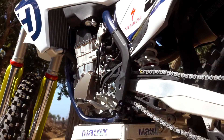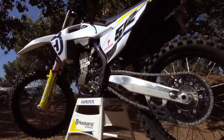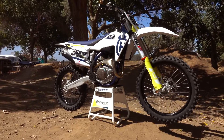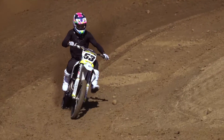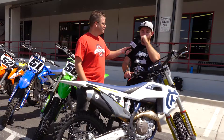If you look at the frame and subframe junction, that's a big chunk of area that can flex. Another big difference that a lot of people overlook is the swing arms — they aren't the same. The Husqvarna has a different swing arm; one of the outer castings is cut quite differently. So the Husqvarna flexes more overall, and the subframe flexes more too, giving it a softer, more supple feel throughout the entire chassis. This year they tried to match the suspension character to that.